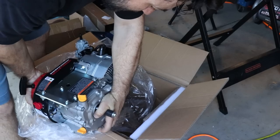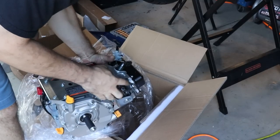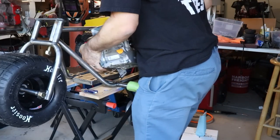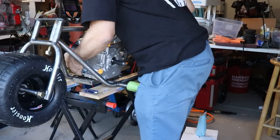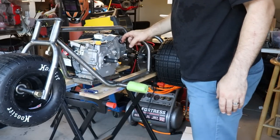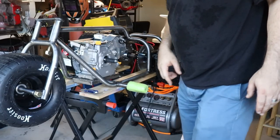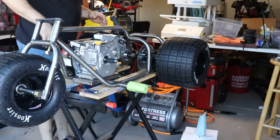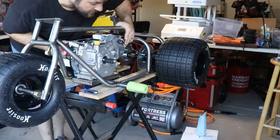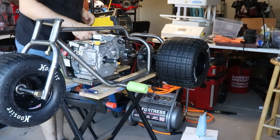So it's gonna go in the cart this way. Output to the driver's side. Exhaust port there. Torque converter bolts on here. Right about there. So our exhaust, we have to make the exhaust. Not a big deal. Competition use only. Wow, carb sits really close to that rear tire. Probably keep this as far forward as possible. I'm gonna have to look and see if those guys are leaving it like that or shortening up this intake